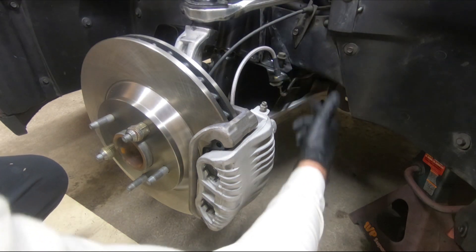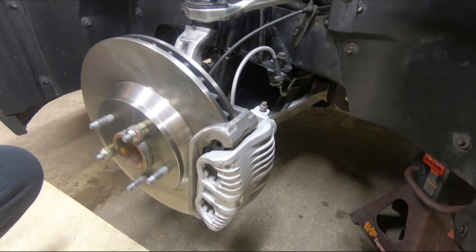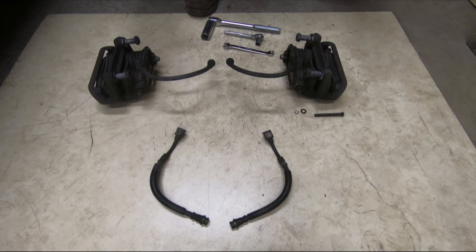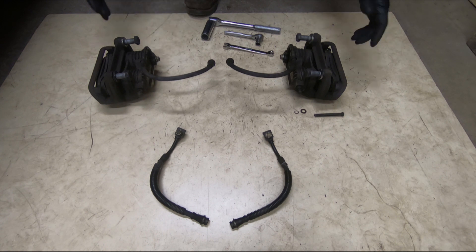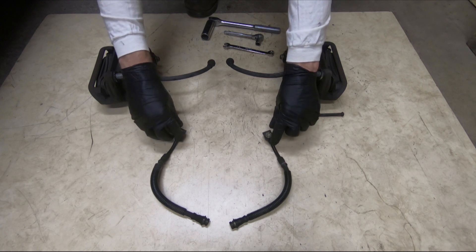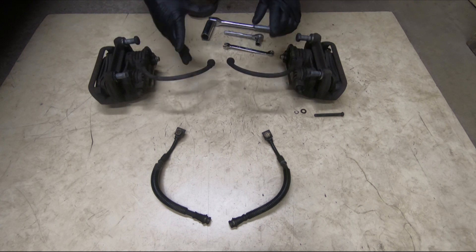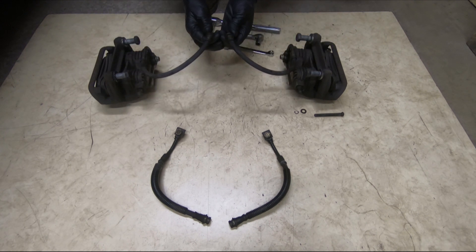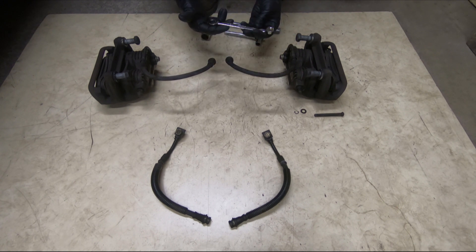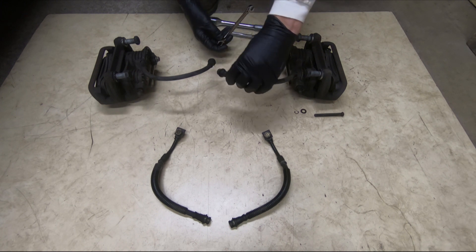There's a bracket right here. Everything else I can show you in the exploded view — I just could not show you this clip. Okay guys, here is everything that I removed from the car. These are my two rear rubber brake lines with banjo bolts. These are my two front calipers with the rubber brake lines. Here's the fitting I was talking about — you use a 12 millimeter brake line wrench, you remove the nut from the bottom, you pull the clip out, you pull the hose out of the bracket.